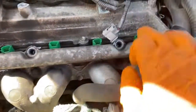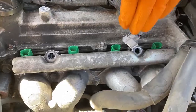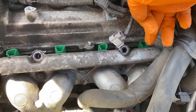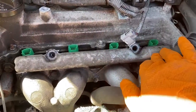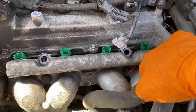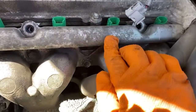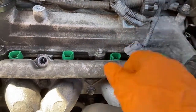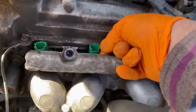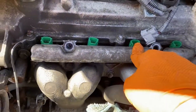Okay, so there was a little bit of wrestling, but again, I started by getting all of these into those O-rings that are on the engine, and then started with lubricated O-rings on the top of all these. Started with 4, which once that found its way home, it wasn't too bad. 3 was a little bit miserable, and I'm a little bit suspicious about it because it feels tighter than all the other ones. I actually took it out and re-lubricated the O-ring and put it back in, and it still does. And because they can kind of rotate, but number 3 feels like it doesn't want to. So that's the first one I'm going to go to if I have any issues with leaks.